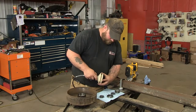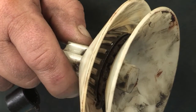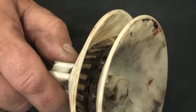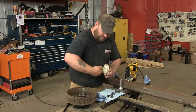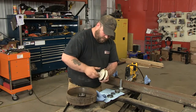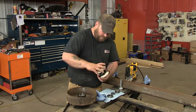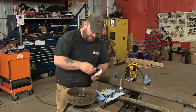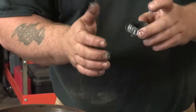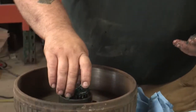As you can see, it's starting to come out. Give it a little more and that's pretty good. Then you just unscrew it. I also did the inner bearing here, so we've got that. Grease is all the way through — she's nice and greased up. So we're going to drop that back in the hub.